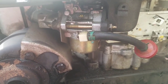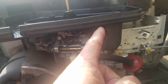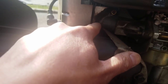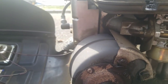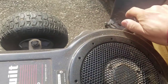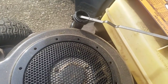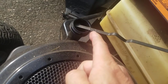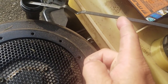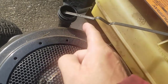Gas is 10% ethanol, and ethanol gums up. So if it gums up right around the seat and needle area, it will not have a good seal, and therefore fuel continuously runs into the reservoir, overflows in the carburetor, trickles down through the intake manifold into the combustion chamber and into the crankcase. I confirmed this by checking the oil — I did an oil change before putting it away, and the level is now way above the full line. There's like two liters of fuel in there.